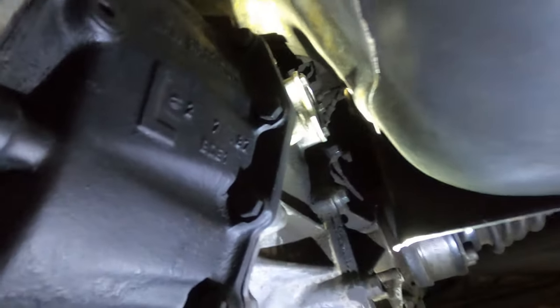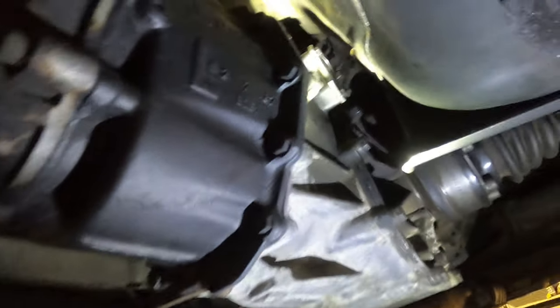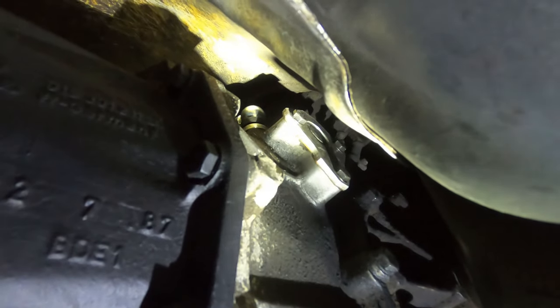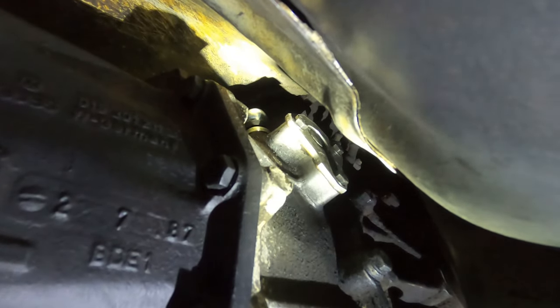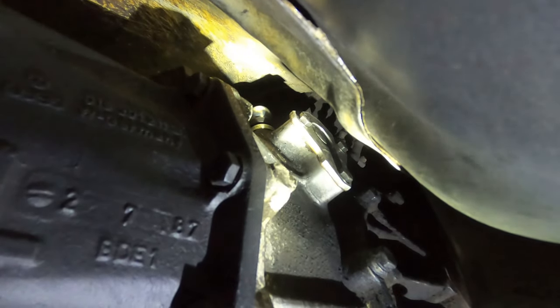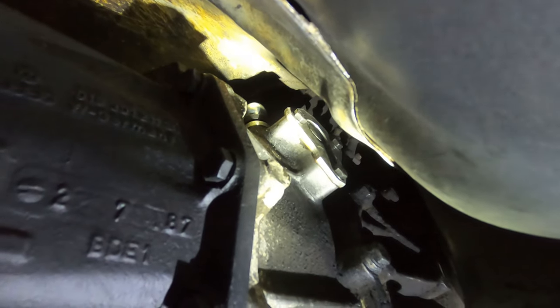The first thing you want to do is remove the detent nut. It's a 17mm cap nut, under which is a spring and a hollow metal pin. It's a little bit difficult to access — I found it easier to come over from the left side, as the nut sits behind the connection point for the linkage arm. With the detent safely removed, you can pull the three 10mm bolts on the cover plate and reinstall everything in reverse order with the new seals.